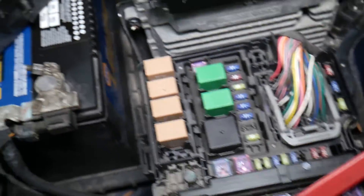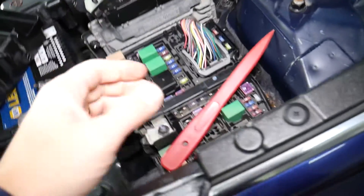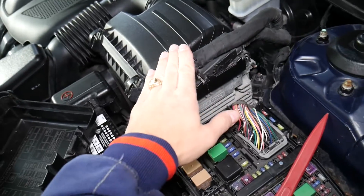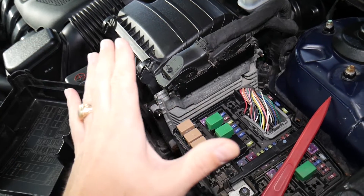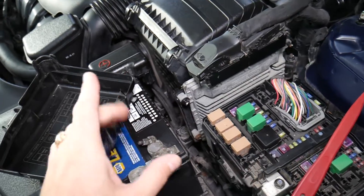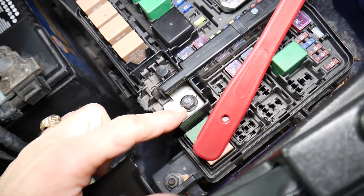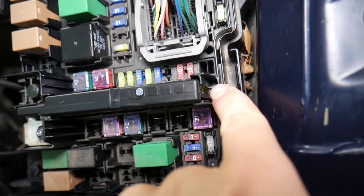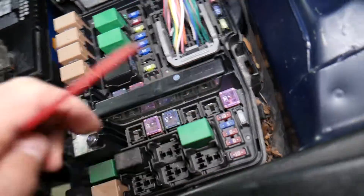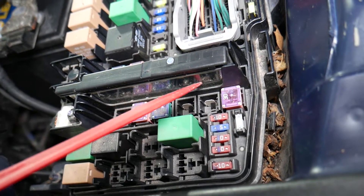If you can't visually verify the fuse, you'll need to disconnect the car battery to test it. On modern vehicles it really matters which terminal you disconnect and reconnect first — doing it the wrong way can kill your engine computer or electronics modules; we had that happen and it cost us $2,000. We have a video explaining how to properly connect and disconnect the battery — link in the description. Remove the nut, remove the tooth holding the fuse in place, pull it out, and test with a voltmeter — make sure you have a continuous connection. If not, the fuse is burned.